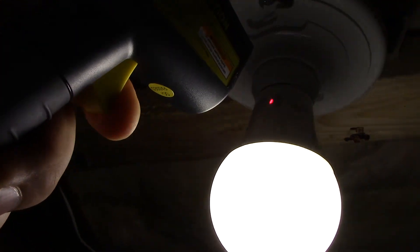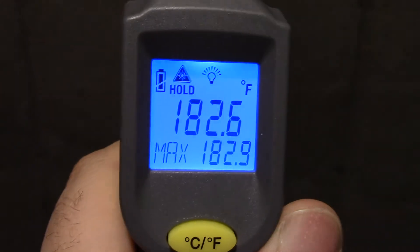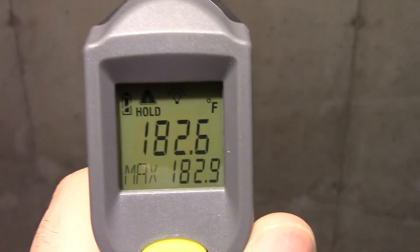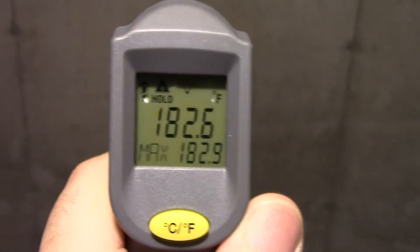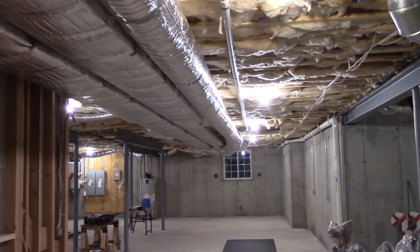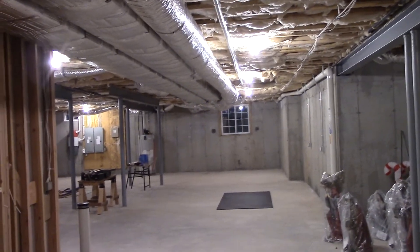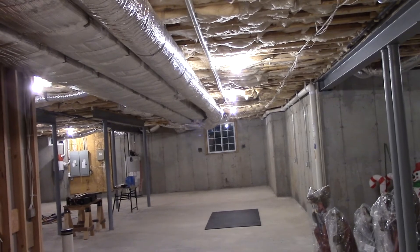Look at that, 183 — it went up to 182.6. Now, is this as hot as an incandescent light bulb? It probably isn't, but that's not a safe temperature to touch. The claim of them not getting hot is only half true. To be fair, the Cree bulb does use less wattage — it's only a 60-watt equivalent while these are 100-watt equivalents. Fair warning: if you take out an LED bulb that has that white plastic part, do so at your own risk. You can probably unscrew it from the clear portion totally fine, but just don't touch the white plastic part. Or just shut the bulb off, let it cool for a while, then take it off.